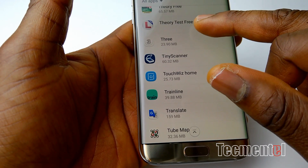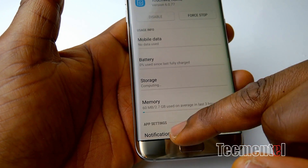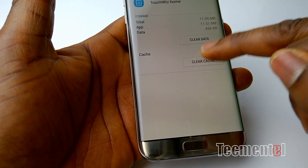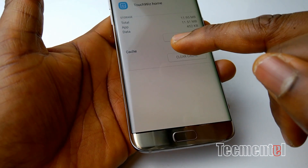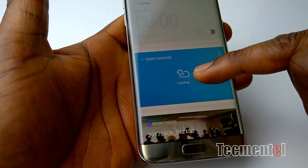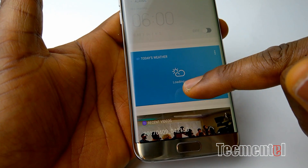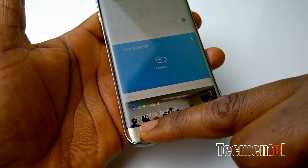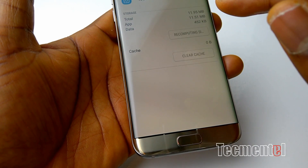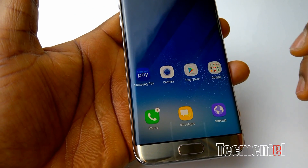Okay, that's the TouchWiz zone. I'm just going to go to storage and clear the cache memory — let's see if that helps. Still loading the application, the weather now. I think we're still having the same problem. So what I need to do next is clear the data. Now let's see. Yeah, because I've cleared the data.